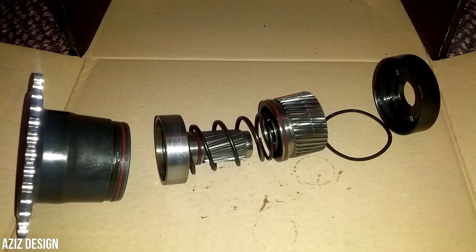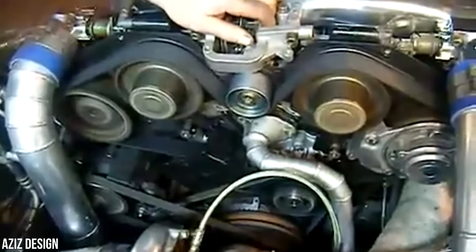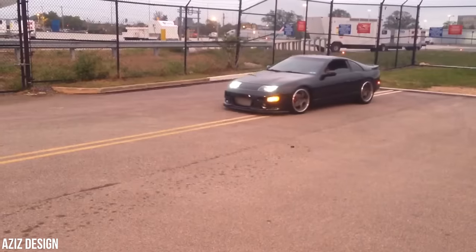Also, brakes are used a lot because the car is really heavy — they're going to need to be repaired more. If you have OEM brakes, consider yourself needing to upgrade them. It's going to help you, it's going to help me, and it's probably going to help the person you might accidentally rear-end. Something really interesting you may not know: turbo models before January 1990 and NA cars before July 1990 had defective valves that just unscrew themselves, causing catastrophic failure.